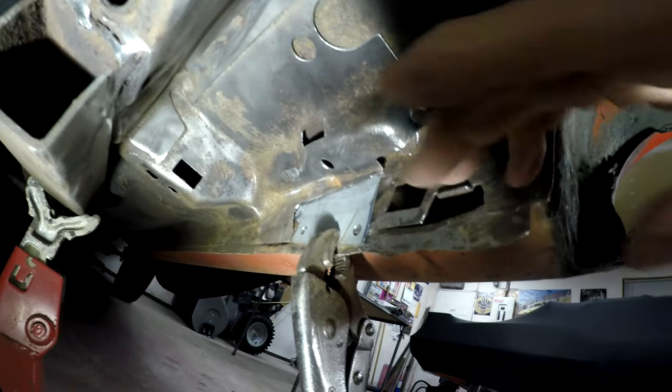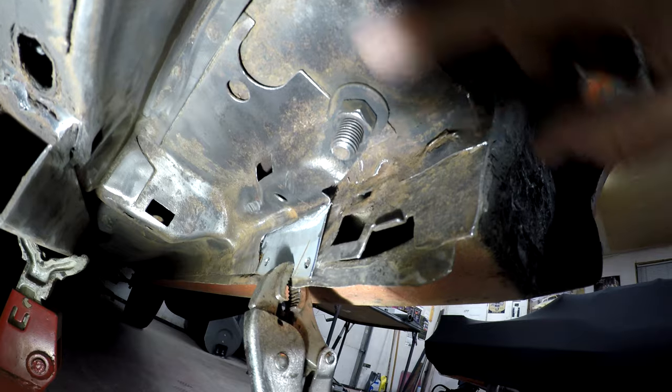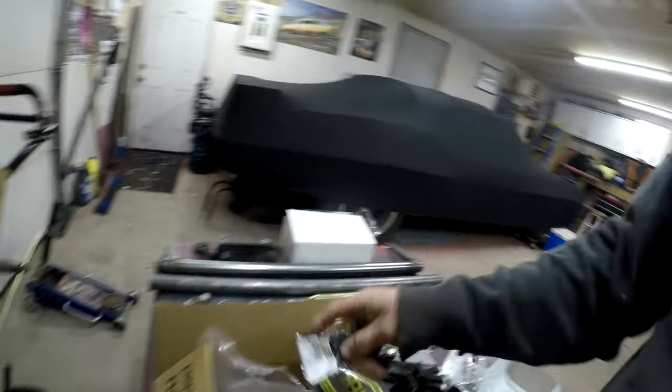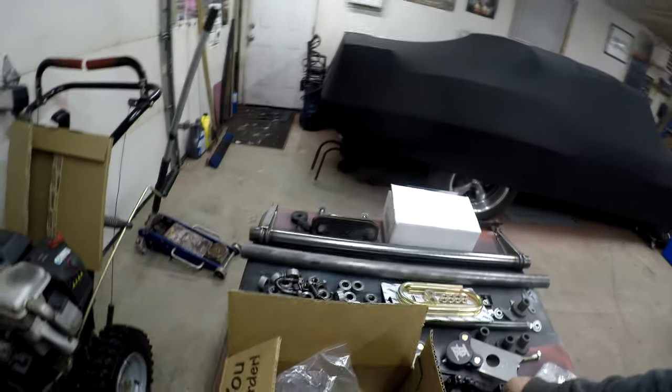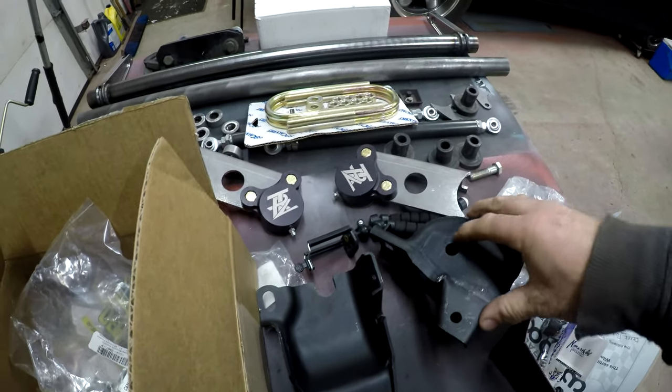I made a patch and it's in here, so I'm just going to weld that in and then it'll be all fixed up and ready for a coat of primer. Once that's welded on, I'll be able to test fit — put the clips in. The clips I bought will be installed and then these brackets can get bolted in so I can figure out where I have to drill the hole. I also want to reinforce both sides with some washers that I'm going to weld on there.